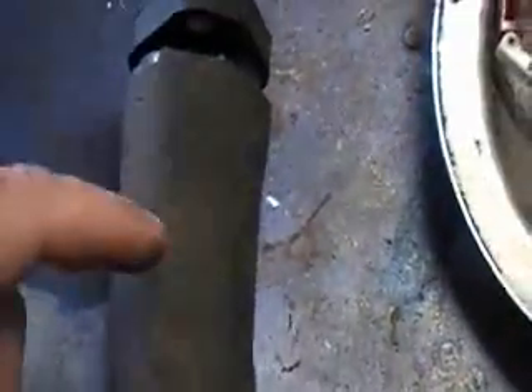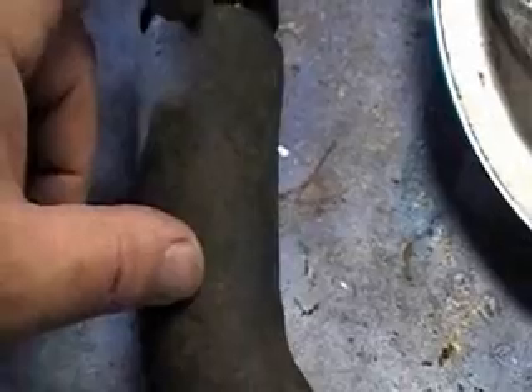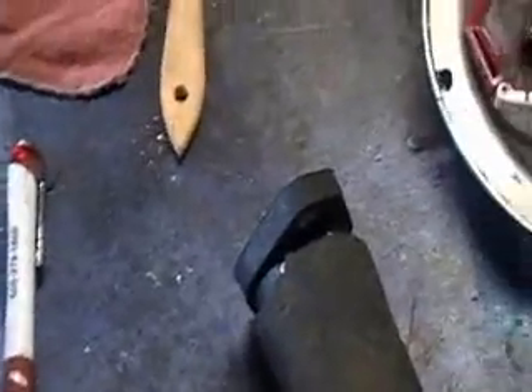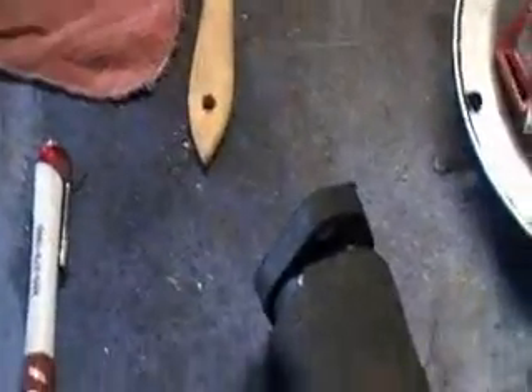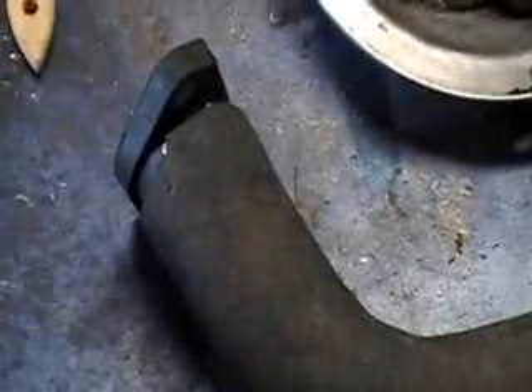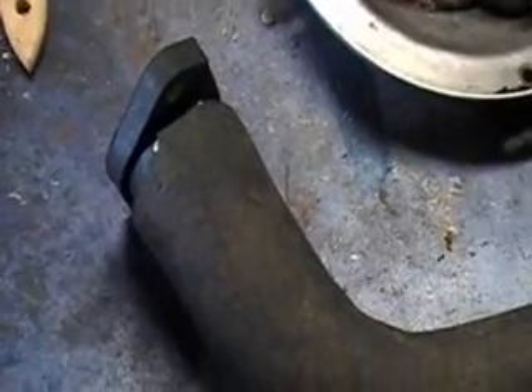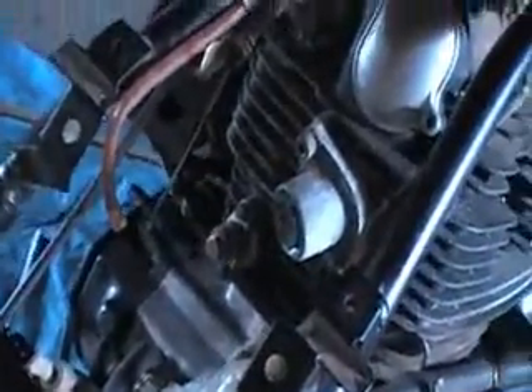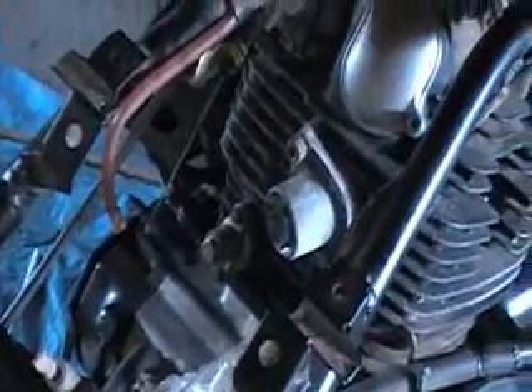What I'm going to do is fabricate this piece just a hair longer. Theoretically it should act as a ram air intake, just like on an automobile. I'm not going to go overboard with it, just a little bit. And if it doesn't run as well, then I'll shorten it back down to the OEM size. So without any further talk, let's go ahead and remove this flange from the engine.